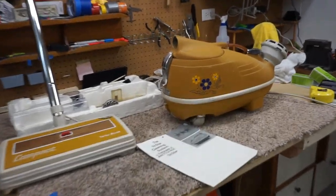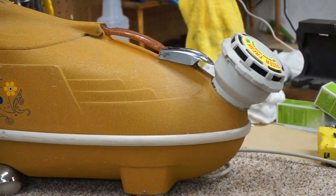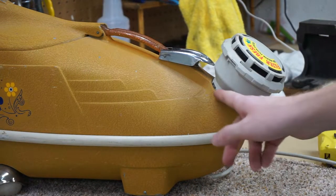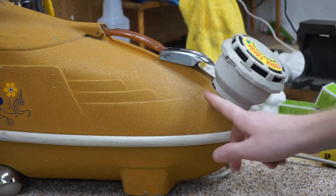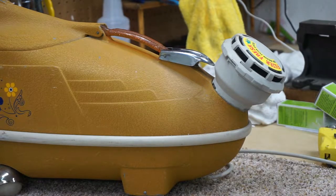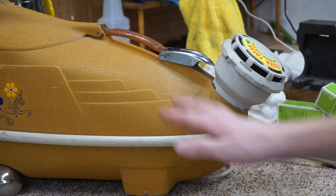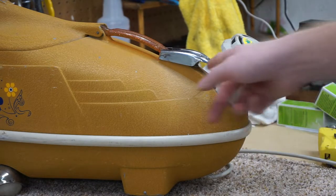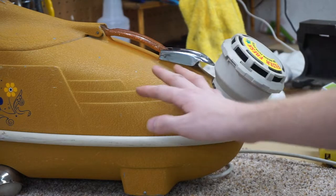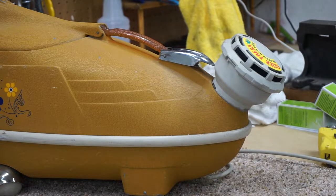Now, the one thing that is different about this is the HEPA filter, or lack of HEPA filter. It's an exhaust filter. These are not sealed from the factory very well. So one thing that was done to this, because it was my daily driver for a little while, is there's actually a small silicone bead I placed in here, and silicone will come off without hurting the paint, but the purpose of that was to seal that properly. I also put a little bit of silicone around the switch and around the cord, so this is actually a sealed Tristar, just to make it appropriate for day-to-day use.